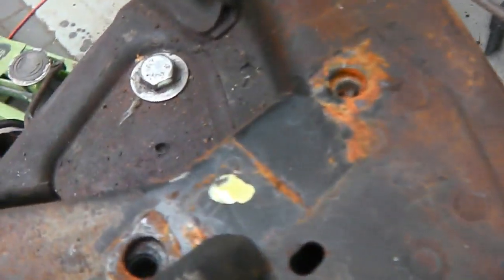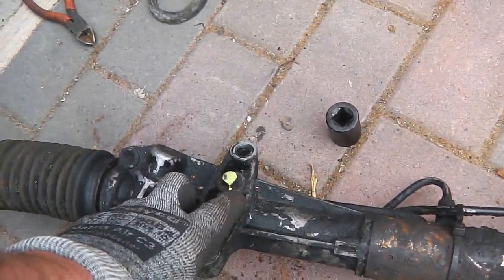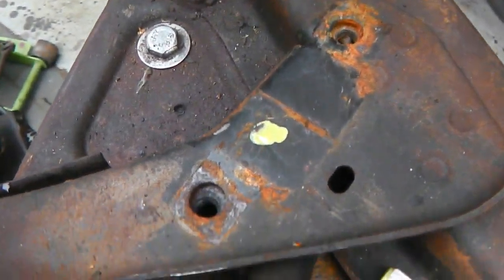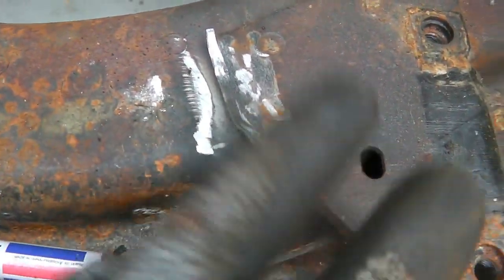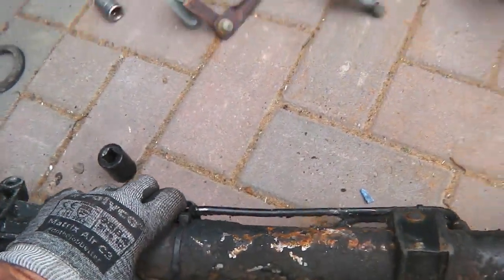But first, got to make a little mark, because it has a Mark 5 power steering. So we make a mark for the Mark 5. A little bit of yellow paint on there, because the power steering rack needs an index tab, like a hole. So we just got to put a hole in there, and we need to scallop out a little bit of metal on the rib of the clip, just so that it clears this tube section there. That's about all you got to do. Other than that, the bad boy fits on.